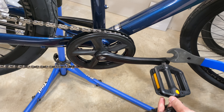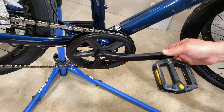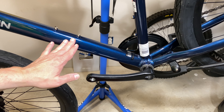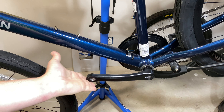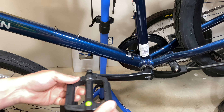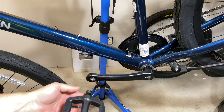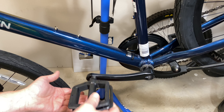When it comes to putting pedals on, usually there is a sticker, and often there's also one on the crank. You'll see there's a rotation direction, and this is easy to get confused because you're looking at it in one plane while it's rotating in another. The right pedal threads on clockwise just like normal. The left one is a little different, but we'll get to that in a second.